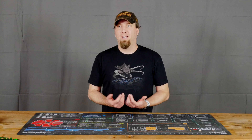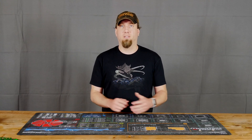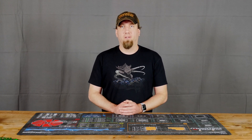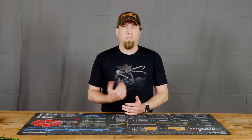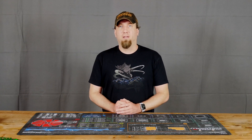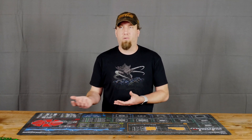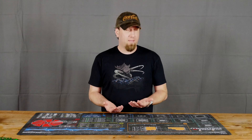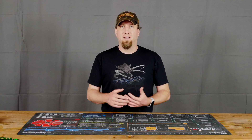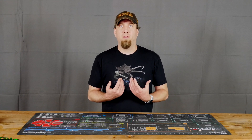We've now set up the Dream Machine and it's a pretty awesome experience. The thing is completely silent — when I had it powered up on my desk, I couldn't hear it at all. In my server rack, definitely can't tell it's there because there's a lot more stuff inside that's a whole lot louder. Now, should you get this? If you already have a UniFi setup with the Security Gateway and a Cloud Key, it's probably not going to be worth buying this since you've already got everything it does. The only thing you'd be gaining is the ability to turn on IPS and still get 1 gig bandwidth in and out of your network — which is pretty awesome, and one of the main reasons I got it.